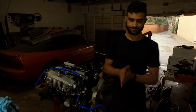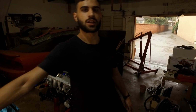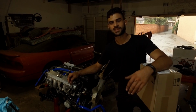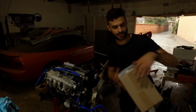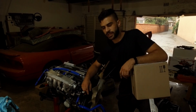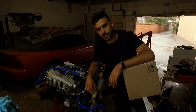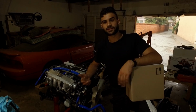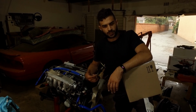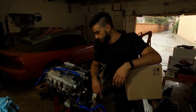Okay, back to what we were busy saying before we were rudely interrupted. So we're going to be making our own engine mounts. We're waiting on Tyron to send us the dimensions of his. And we're going to be making them out of polyurethane, right? We're going to be getting the end caps made by getting them laser cut. Hope this isn't too loud. I don't know how this is going to sound, but we'll hear. So we're going to get the end caps laser cut. We're going to make the actual mounts out of polyurethane. And then we're going to chuck the engine in.